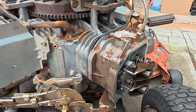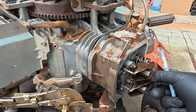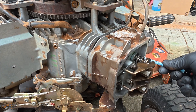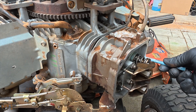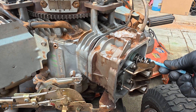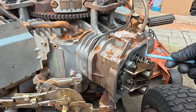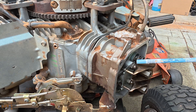I'm going to readjust it back just a little bit. We have our loose rocker arms. I'm going to take a pencil and stick it in the hole where the spark plug goes. I'm going to back it up a little bit. You saw the pencil go down — I'm going to come back up. Pencil's coming up, now it's starting to go down again. Right about there is the top dead center of the compression stroke. We are now at top dead center of the compression stroke, so we can start gapping.